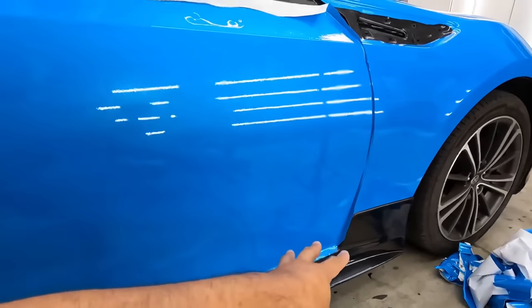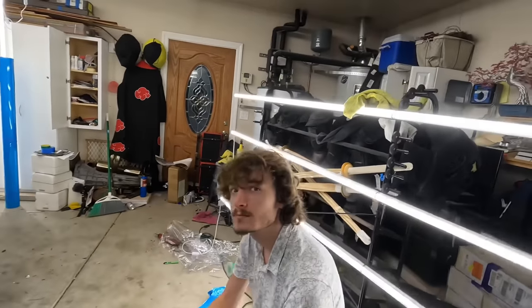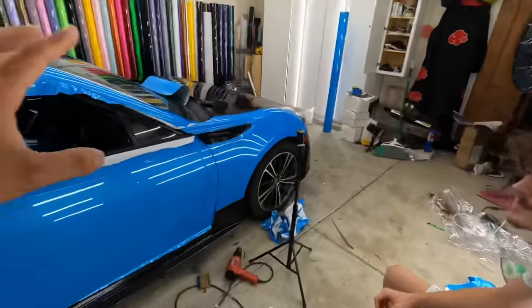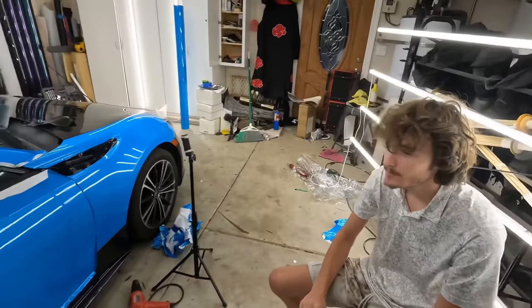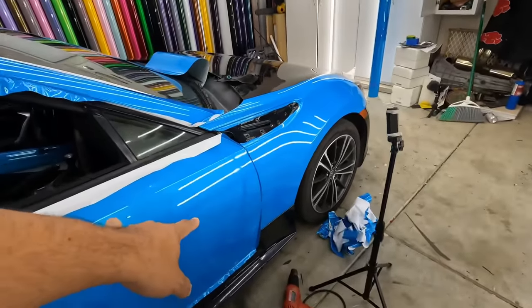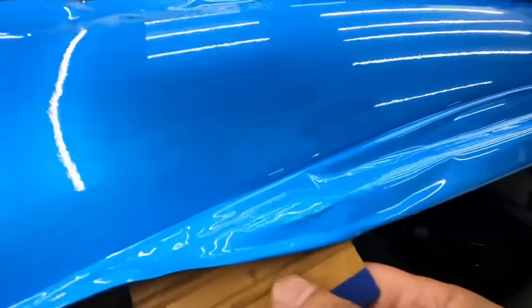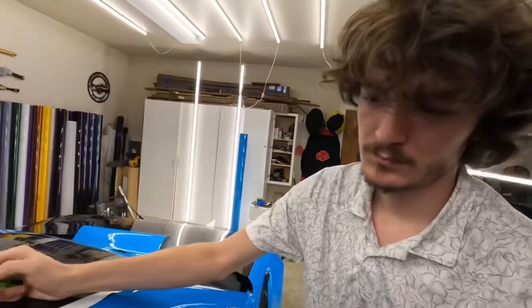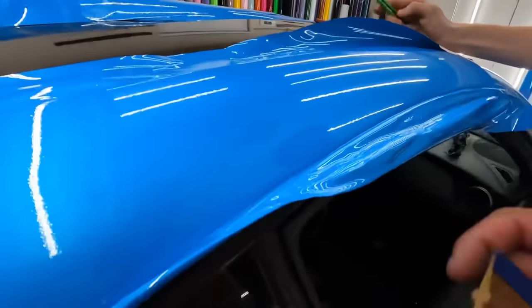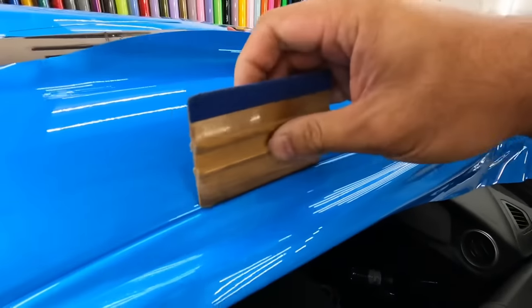Okay? So, right now we're going to keep the door as it is because we don't know if you're going to have enough material to finish the car. So, you're just going to have to leave that, and if you have any material left over at the end, that's when you redo the part you messed up. So, if you cut on the squeegee, then you can avoid cutting anything else. You're only cutting the squeegee. No big deal. If you cut your seal all the way through, then now your car is leaking water when it rains. Okay? So, what you want to do is tuck it in first like this, and then how I do it...